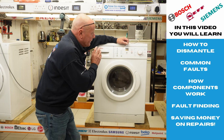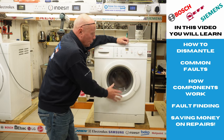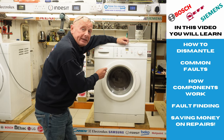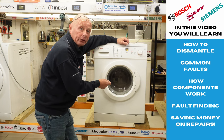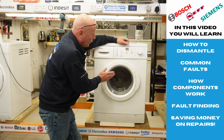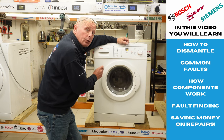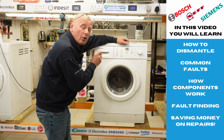The machine itself was very well built — good program, good working components. A few little repairs may have been needed over the years: carbon brushes, blocked pumps, leaks on door seals and so on. But the machine was easy to work on. As you can see now, the machine is running at approximately 400 rpm and it's quite quiet, but as we go to a higher spin RPM the noise will become horrendous.